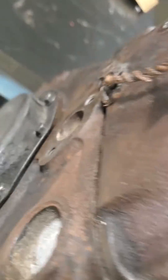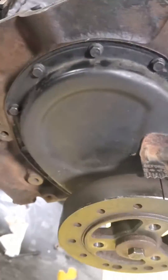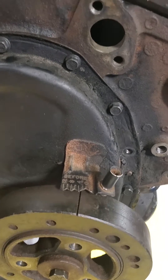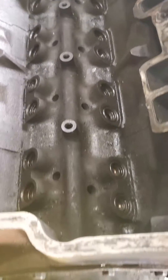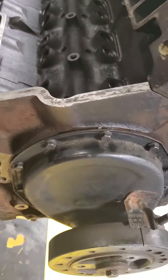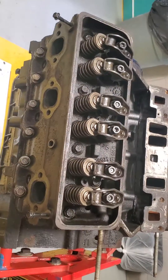So this is an older engine. It looks very similar to the newer ones. The major giveaway for a roller lifter cam is that plastic timing cover versus the old metal timing cover. So if you get an old metal timing cover, more than likely it has flat tappet lifters. It is possible that somebody could put roller lifters in with the lock mechanism, but more than likely it is an older flat tappet lifter engine.